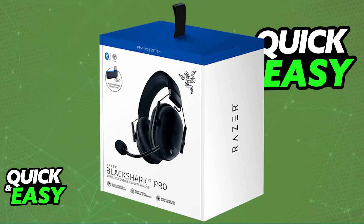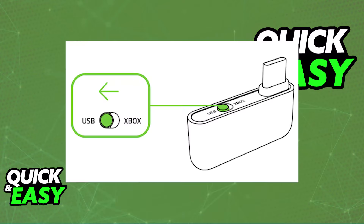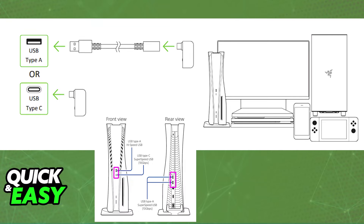If you have the one designed for consoles, there will be a little Type-C wireless dongle included instead of the standard USB-A dongle. By using this Type-C wireless dongle, all you have to do is set it to USB mode. If you look at the toggle, you will be able to set it to USB, and once this is done, plug the wireless dongle into your device. If you have a PlayStation 5 console, you will usually have access to a direct USB-C port and can connect it there, or you can use the provided USB-C to USB-A adapter that Razer includes. Just make sure the USB-C wireless dongle is connected into the console and being properly detected.